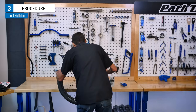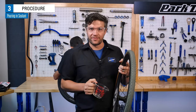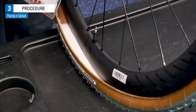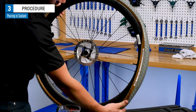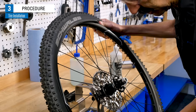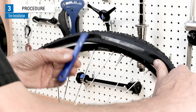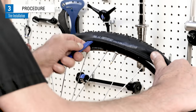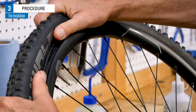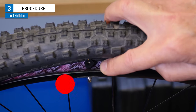Stop! If you're not going to be injecting your sealant and you're going to be pouring it in, now's the time to do that with the tire about three quarters installed. Give your sealant a good shake and pour in the appropriate amount, typically two to four ounces. Once the fluid is installed, rotate the tire so the open section is at the top, then continue to install the tire. As you continue, keep checking that the tire is in the channel — this second side can be even tougher than the first bead. Try your best to do this without any tire levers; if tire levers are needed, use them while preventing the other bead from slipping. Once you have the tire fully on, double check that the beads are on the correct side of the valve. The valve needs to be between the beads and should not be visible on the outside.